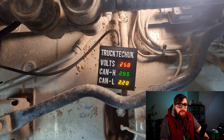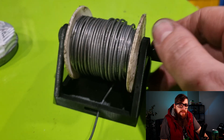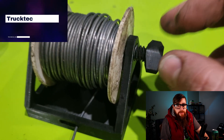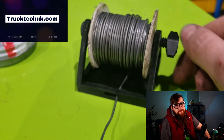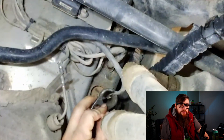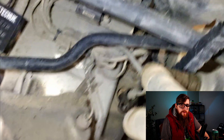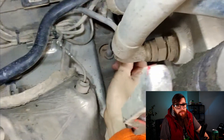I can't get over the fact I can now print threads with this thing. I've started adding these products to my website for purchase — if they make my life easier, I'm sure they'll make your life easier too. Anyway, with the power, ground, and CAN signals showing the correct readings, we'll need to remove the sensor for the next test and run the NOX monitoring test through Davey, where it will test the performance of the heating element and the NOX sensor.